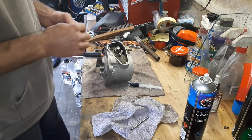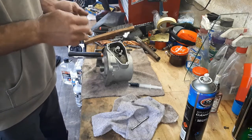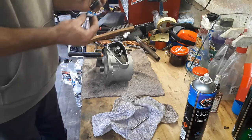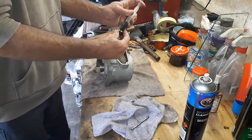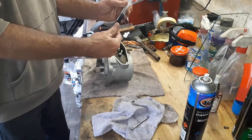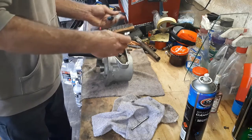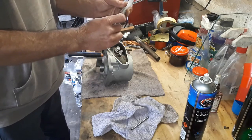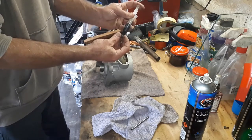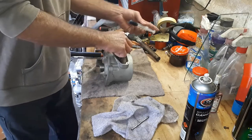And also the two bearings on this side here. Just make sure they're still running nice. And I'll put just a little dribble of oil inside these as well. So I think that was the inside one. A little dribble in here as well. I'm not going to do the outside of these because that should be where the mating surfaces are. So we can push that in.